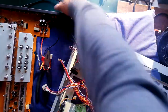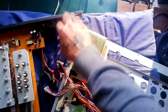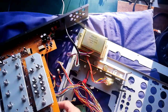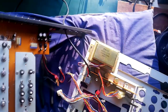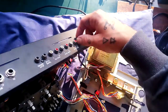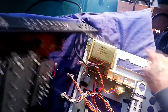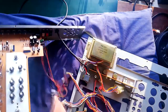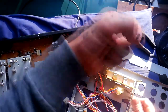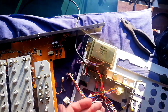These parts are still attached because the cable going to the power switch runs through a plastic fitting — I think there's a specific tool to undo it, but I don't have one. To get this away from the backboard, I need to remove five quarter-inch jacks and three plastic clips. Without first removing the screws that hold these two metal parts together, there's no way to access the black clips. To remove a clip: push the pin in the center through, the splayed part closes, and the whole thing comes out. When reattaching, pinch those together, push through the hole, and push the pin in to splay and lock it in place.